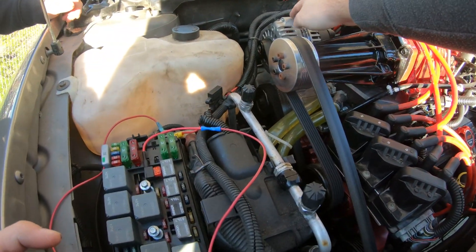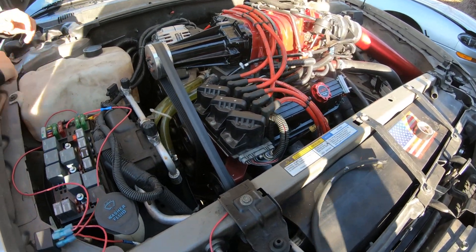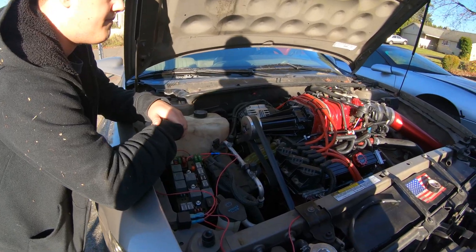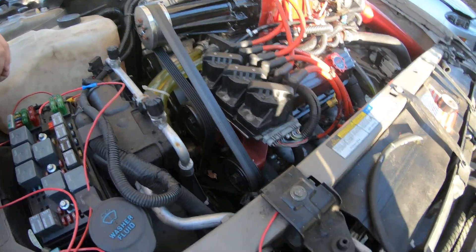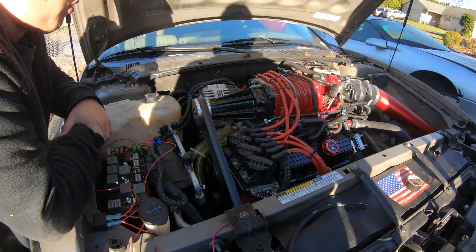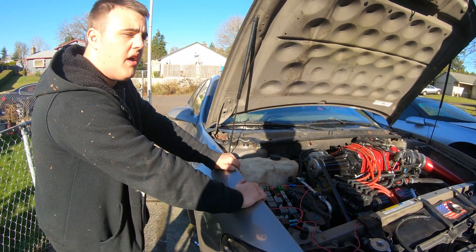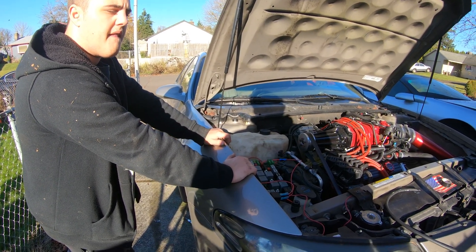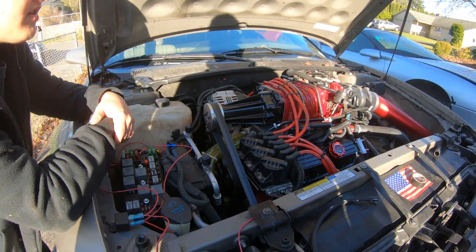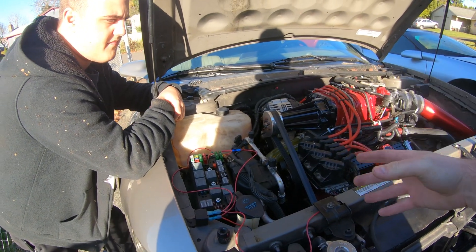Supercharger, intercooler lines. I would say the alternator, the coil packs, and then the water pump. The water pump won't need to come off, but do some of the water pump bolts go all the way through into the block to hold on the cover? I don't think so. Did we RTV this or is this a gasket? This is a gasket job. So new gaskets for the cover — I feel like replacing with a gasket will be easier than having to get RTV down there. Timing cover gasket, water pump gasket, new gaskets for the supercharger and then the intercooler. We'll compile a list for the Bonneville of what we need.